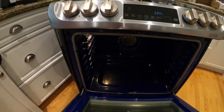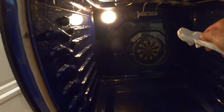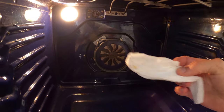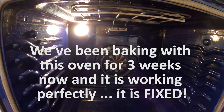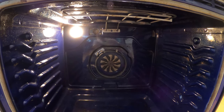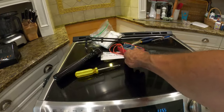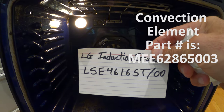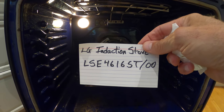We can do a little bit of the paper towel test. Holding the paper towel on the element, we get brown — it's heating. I'm surprised the element doesn't get red hot; perhaps the airflow from the fan solves that. The oven is properly heating up to 350 in 10 minutes. Problem solved. And again, there is no hidden bake element under that pan in this product. The new element cost me about $95 with tax here in Canada. So if it's a hundred bucks every two and a half years to fix it, that's ridiculous. We'll see what happens.